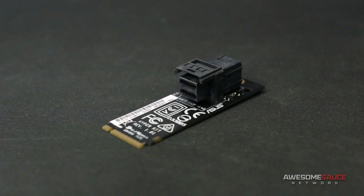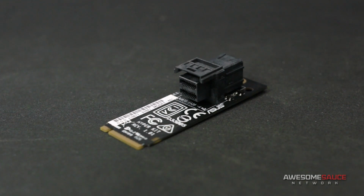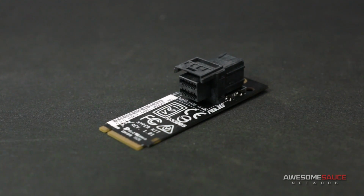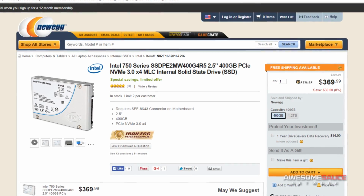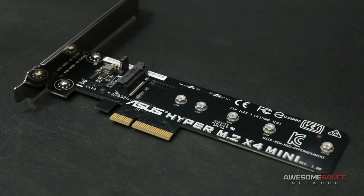And just for good measure, Asus has included their HyperKit adapter, which connects via M.2 in order to provide support for crazy fast U.2 drives such as the Intel 750 series NVMe SSD. Finally, there's an included M.2 PCIe x4 card adapter, which can be used for RAIDing multiple SSDs, along with integrated options for U.2 and M.2. If ever you should find that this board isn't meeting your storage needs, Asus technical support will inform you that the problem is you.